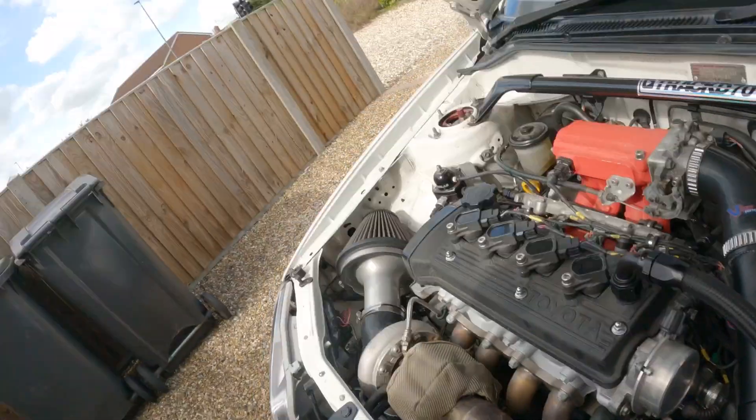There's so much on this — it's actually ridiculous. AN6 custom Teflon fuel lines used wherever possible, a custom oil cooler consisting of a Setrab 13-row oil cooler, a billet aluminium cooler, an anodised sandwich plate incorporating an 80-degree thermostat, and AN10 braided lines. These are quite popular. I think I need one actually for my turbo — the garage said I should upgrade to AN lines, so that's on the job list.